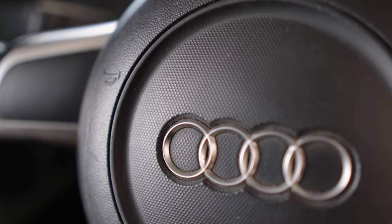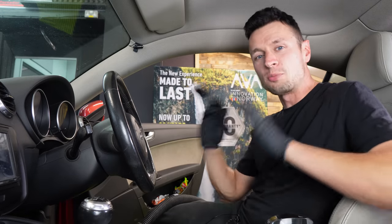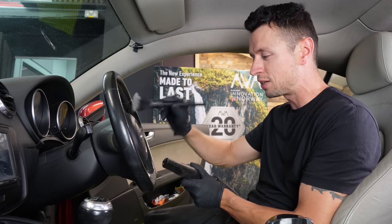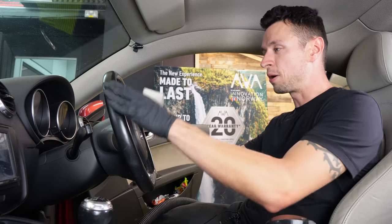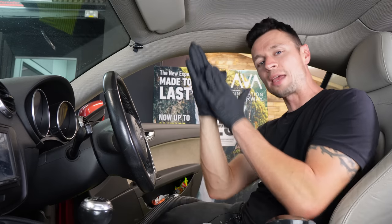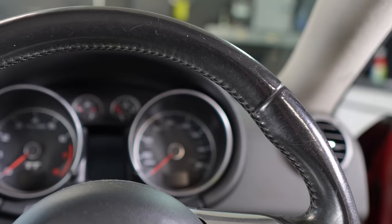Now we have the essentials, let's crack on. The first thing you have to do before you even think about scrubbing is remove all the light dirt and dust. All we're going to use for this is a delicate soft brush and a vacuum cleaner — just lightly flick the dirt into the vacuum whilst it's on. Now there's a very good reason why we do this: if you do have dirt particles on the steering wheel and you start scrubbing straight away, you're going to get all that grit in between and it's going to become abrasive, attacking the steering wheel.